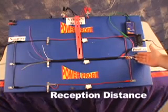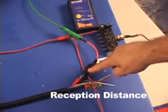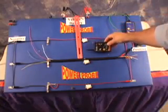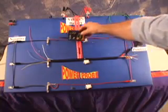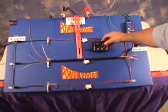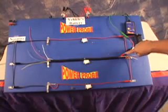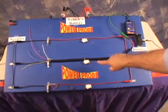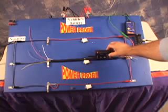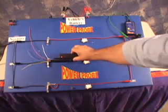It's important to understand that floating parallel wires that are capacitive coupling are weaker than the signal that is connected directly to the transmitter signal lead. You can easily detect the difference between a weaker and a stronger signal by observing the distance of the circuit and the smart receiver at the moment of detection. In our circuit, we're injecting the open circuit signal exclusively into the wire that's leading to the open switch. The parallel floating wires are all capacitive coupling and transmitting open circuit signals along them. As we trace them, we pass right over the open switch.